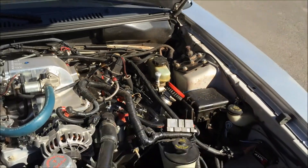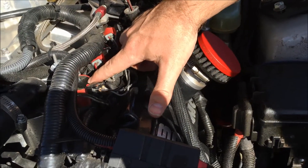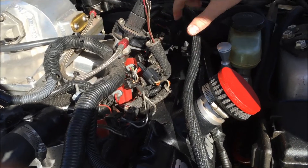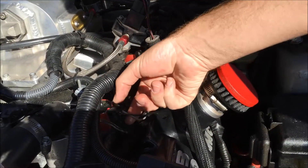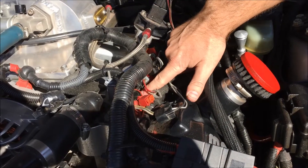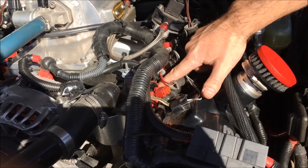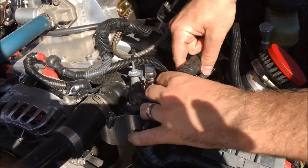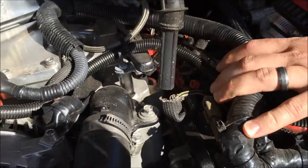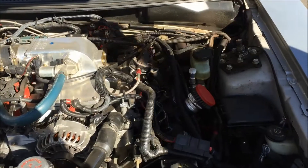The next thing you're going to want to do is find the ignition coils. These are on top of the spark plugs. On this car, you unplug the connector and then sometimes there's a little seven or eight millimeter bolt on here — this one's missing — but basically you take out that little bolt that holds it in place and simply pull the coil out.